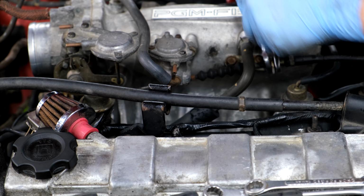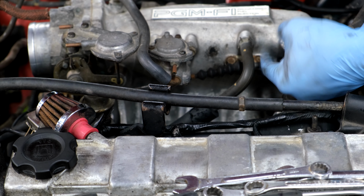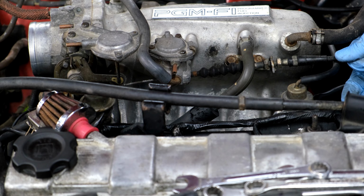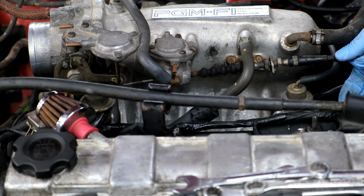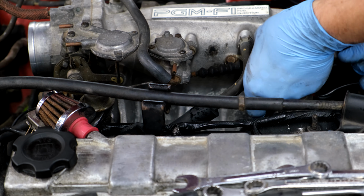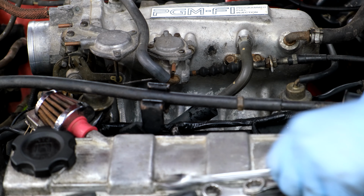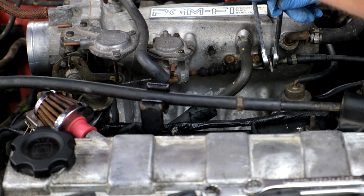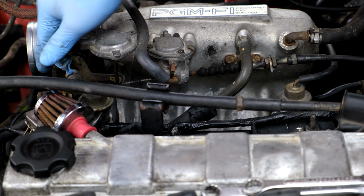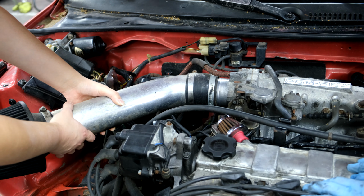There you go. Loosen it. And we're going to pull it, so we need to loosen this bolt here. And we'll pull it till it starts opening the throttle body. See it opening it? So I'm going to loosen this bolt. It should start pulling it in. Got this pretty tight. Now Sydney's going to put that back on and we'll go for another drive.